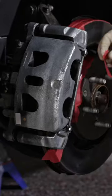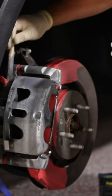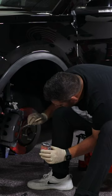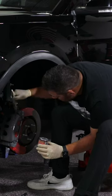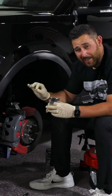The next step is masking off the areas that you do not want to have paint on them. We're going to start with the rust preventative. This is the primer and it's a rust preventative. We're going to let this dry to the point where when I touch it with my finger it's a little tacky but it's not removing paint from the surface.